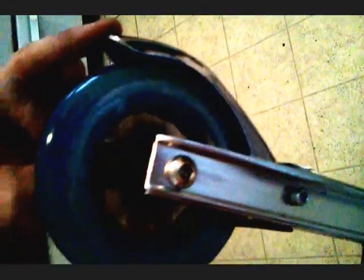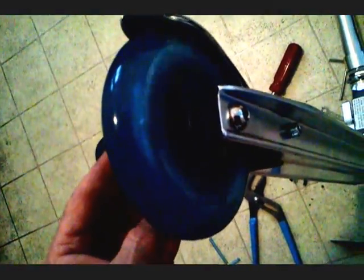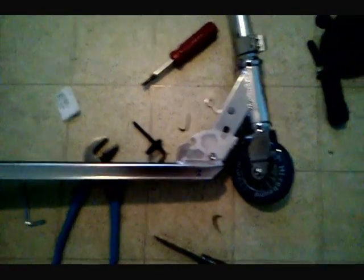We got the black plastic piece cut away and the wheel is spinning freely. I did have to raise the brake a considerable amount — so much that there's probably only about a millimeter of space. But the wheel is there, it's rolling, it's free spinning. I've got two 110 millimeter wheels on my Razor A4 Pro and I'm going to take it for a test drive.